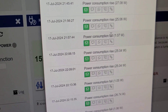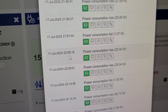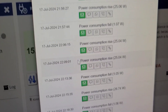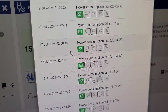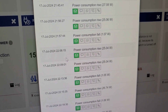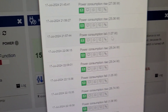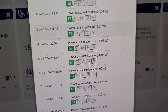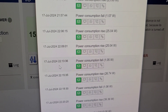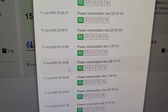The compressor had been working for just one minute for some reason, then it stopped. Power consumption fell to 1 watt — that is standby power — and for about 9 minutes it was off. There's something a bit unclear here, which I think relates to hysteresis. It's quite a heavy topic — briefly, it means that at some point the power dropped below 25W but not below the 2-watt threshold, then rose again above 20W, so we miss it in the log. But then it stopped, then started again after a couple of minutes and ran for three minutes.